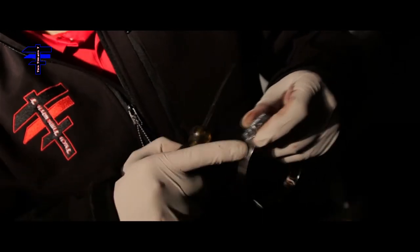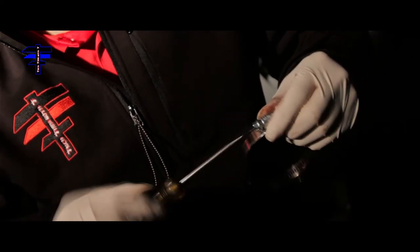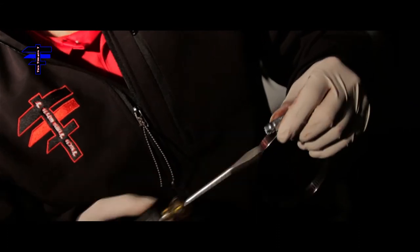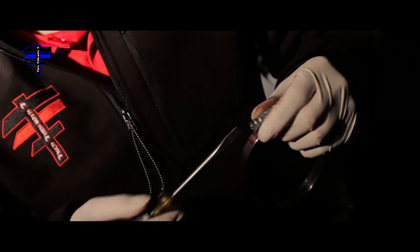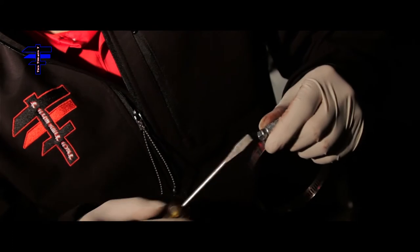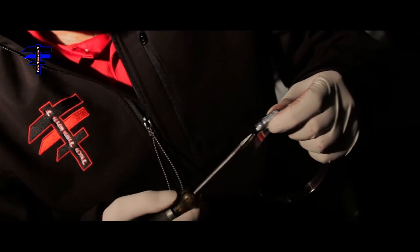As you can see, the flap is going out now and the ring is getting bigger — it's supposed to be like that. Once you wrap the heat shield onto the exhaust pipe, you want to go clockwise to close it back. Keep going until it's completely out, and then you wrap the heat shield on the exhaust pipe and just tighten it in.